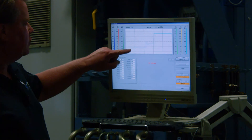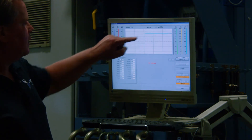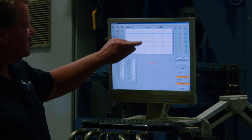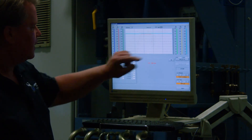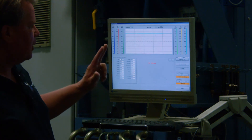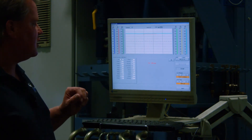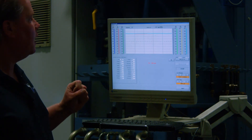As the service tech is shifting through the gears, you can see the clutch trace as the clutch pressure comes up. Each gear is recorded in a different color as he's shifting up and down, so both the engaging curve and the disengaging curve are captured on the display.